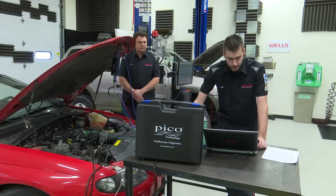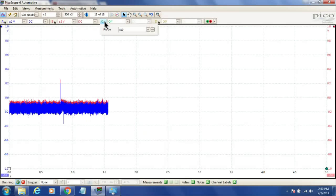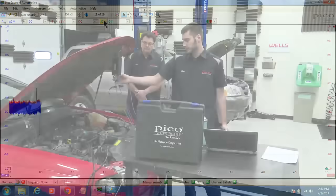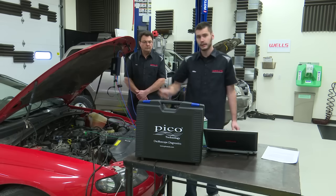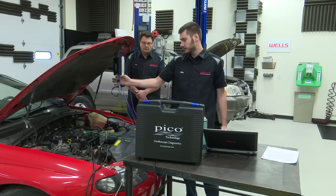So what I'm going to do is I'm going to go on the scope here. I'm going to turn on our channel C, and I need to tell channel C that I have a 10-to-1 attenuator on here, because when you're scoping this fuel injector, you can get a spike that's over 100 volts. So we want to protect our scope. So we're using this attenuator on here to protect the scope.